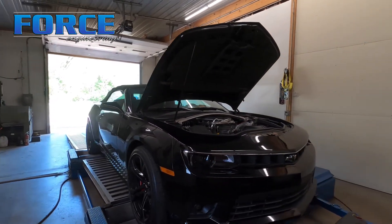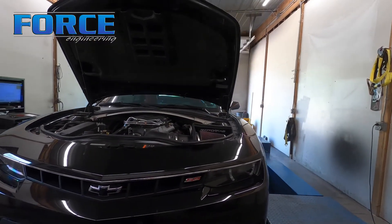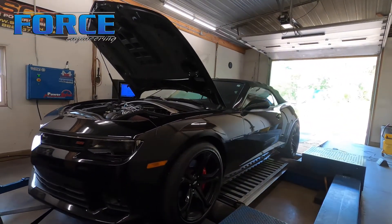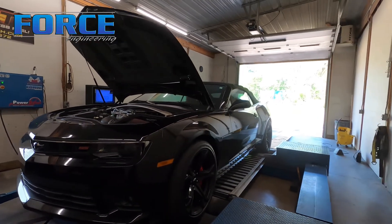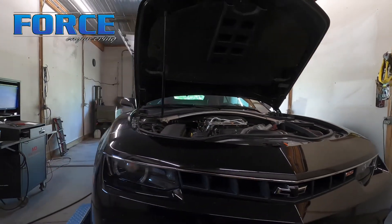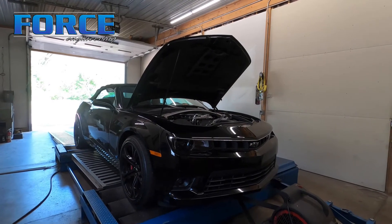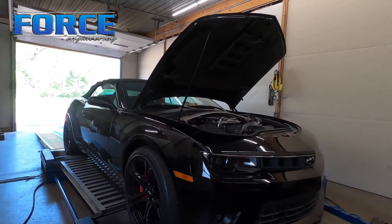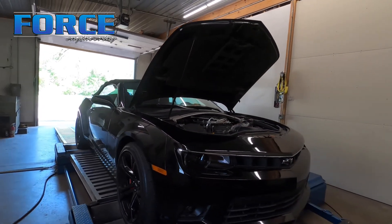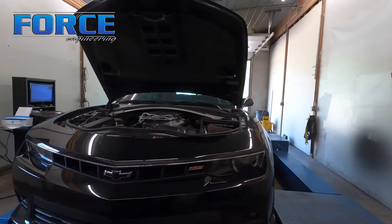We're actually out of fuel injector — we were at 95 percent injector duty cycle at 6750 to 6800 RPM. He wants to make 600 wheel horsepower as the goal, so we're 40 away from that. I think a pulley change and some more injector will get us there. He said this has got LS9 injectors in it currently. All in all, good daily driver deal here at that mid-500 wheel mark. Can't remember what these cars weigh being a convertible — probably pretty heavy, probably around 4,000 pounds. That's it for this one, I'm gonna get it unloaded and move on to the next.